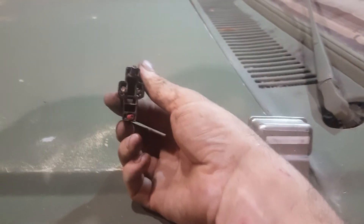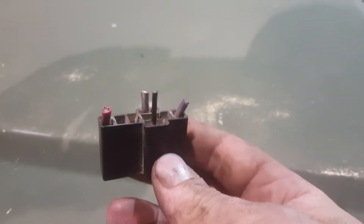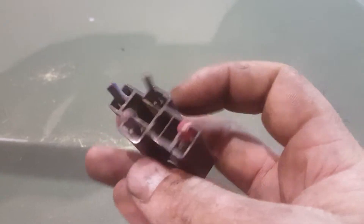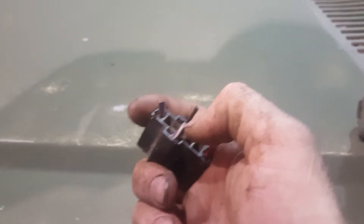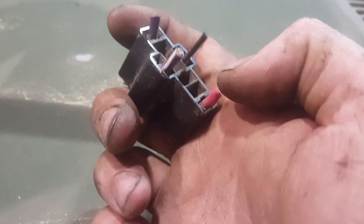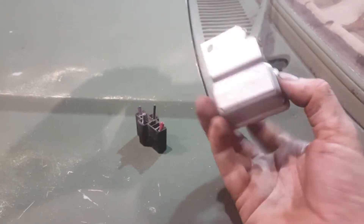From the factory you've got this cross-shaped four-way plug. On it you've got a red wire — heavy duty — and two purple heavy duty wires, one of which has a white stripe. Then you've got the black, which is the ground. The heavy duty purple with the white stripe is your coil trigger wire, the black is ground, the red is power in, and the purple is power out to the starter.